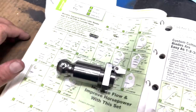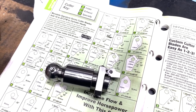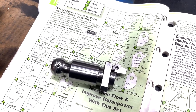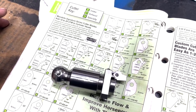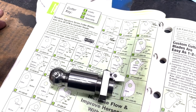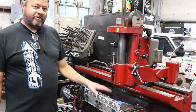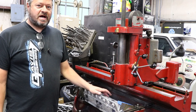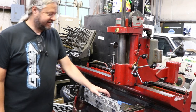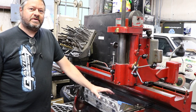Let's move over to the seat and guide machine and scrape some of these seats out. This machine is generally referred to as a seat and guide machine — I don't exactly know why, because most of what we do on it is valve jobs. You'd think you'd call it a valve job machine. But we do seat and guide work as well. This particular machine is a Tobin Arp. It's one of the first machines I ever bought. The Tobin Arp is a company that was bought out by Sunnen. The modern-day Sunnen machine is basically the same machine with a variable speed up top to control your spindle speed.